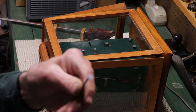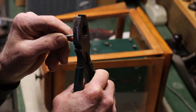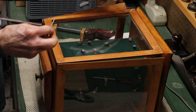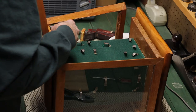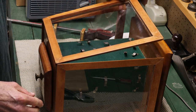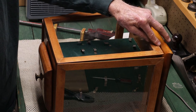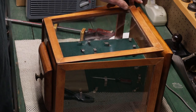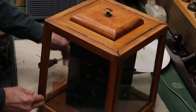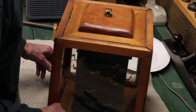The more I do, the better it gets. Here's another nail — cut the head off. We're going to slip it in the hinge, all the way up near the hinge pin or the barrel. Gently drop the door — this is going to spring the hinge outward and take away some of that binding so that the panel will close and rest against the base. It's a little wobbly, but that's the way it was made.